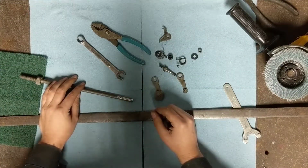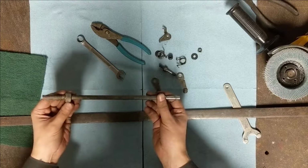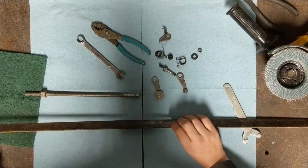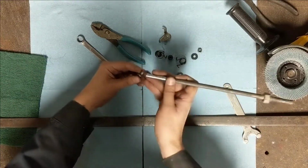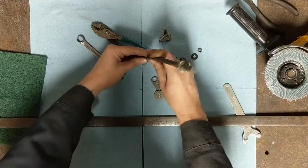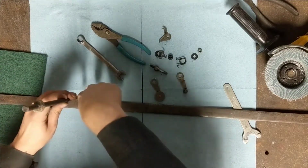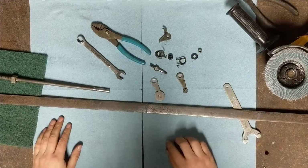And what that's going to do is just use what I've got laying around the shop here. This is 3/8 inch round bar that I previously used as a drift to push out some valve guides, and did it in a damn hurry. And 3/16 by 1 inch flat bar. The deal being that this is going to have to get drilled out so that it spindles on here, spins this way, and winds up this spring. To do that, this is on here with another piece hanging down, so it's beside there, and pulls out the spring this way. Alright, those are all neat words. We'll see how it goes.